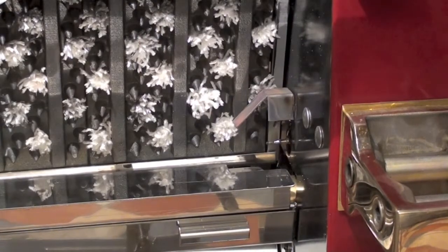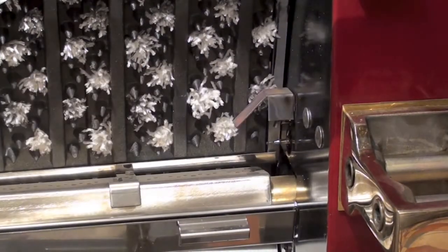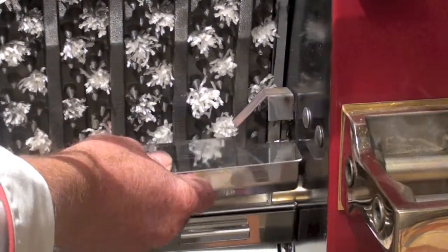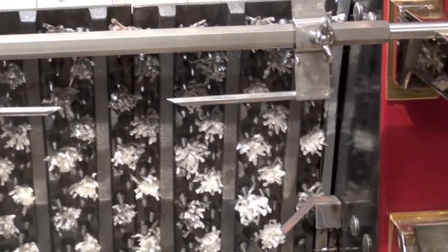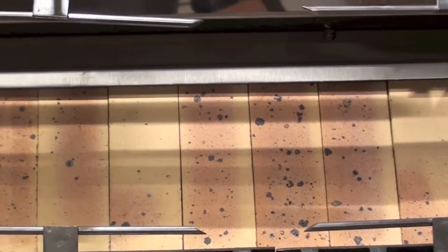On the right-hand side next to the burner is the pilot light and thermocouple. Remove the burner shield and you can see the burner; replace as such. Behind, you have the cast iron plates with the ceramic wings, and above that, the refractory brick.